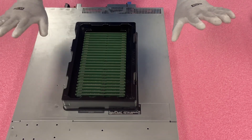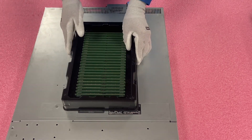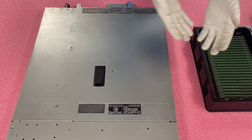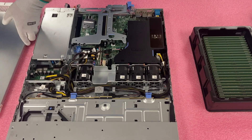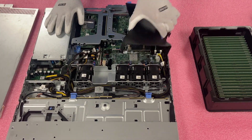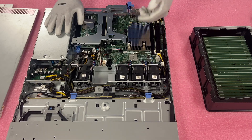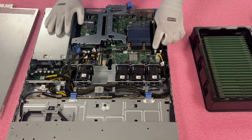One thing I would recommend is make sure you have your ESD gear on to protect the machine and not accidentally damage or shock anything. First things first, we're going to put our DIMMs to the side — that's all that we are going to need for this upgrade. Pop your latch, lift the top like all the other Dell machines you've been in before. We're going to need to remove the air baffle. Now once we remove the air baffle, we have access to the one CPU and the four DIMM slots.